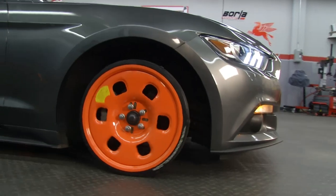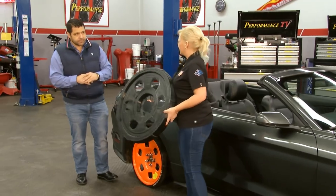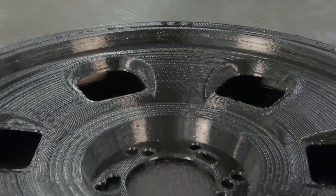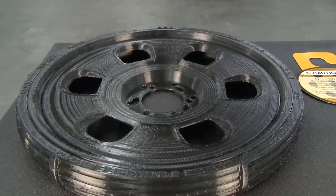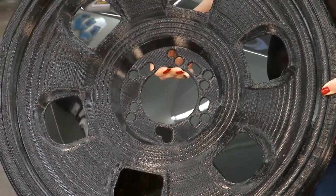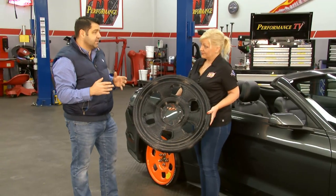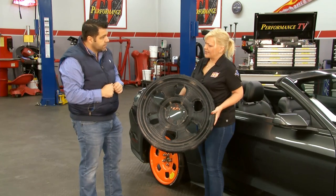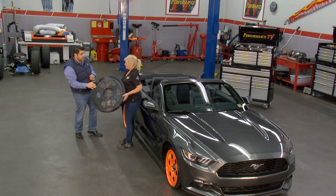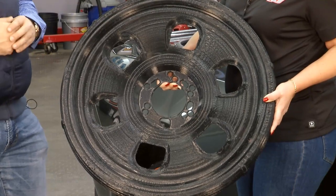You have the Goonie Wheel 45, and I also see you're working on a prototype here for the five and six lug. That's right — this is the bigger wheel. It will cover bigger SUVs and pickup trucks. It's got a much bigger center bore of 110 millimeters and PCDs at 135, 139.7, and 155. That covers a wide variety of SUVs and pickups on the road today. The expected weight limit is probably 2,500 pounds plus, using 4 millimeter steel compared to the 3.2 millimeter on the Goonie 45, so it will have a much heavier load rating.